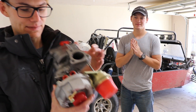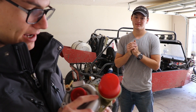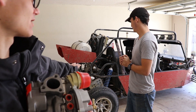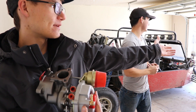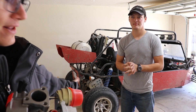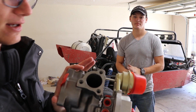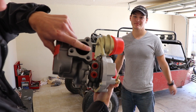This is our $100 eBay turbo we will be installing. It looks pretty nice — it is a K03. We decided to go with the K03 due to the smaller size. This engine is a 1100cc or 1.1 liter. For comparison, our Boosted Miata over there is a 1.6, so this is even smaller than that. Extremely small. So we decided to go with the smallest turbo we could find on eBay. Look at this — that's a perfect size. Index finger for comparison.